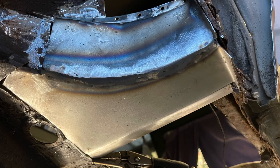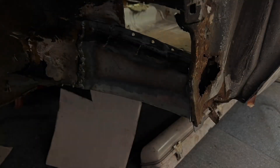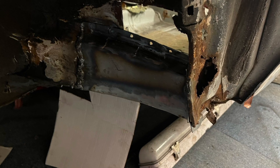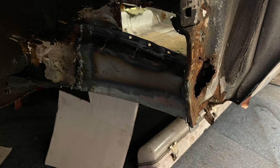I used the folder to put any bends in that I needed. Once I had the new section in position, I welded it up ready to put the inner front floor pan in. This was marked out with a marker pen from below to the shape roughly and then cut oversized - it's the easiest way to do it.